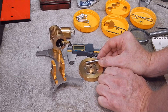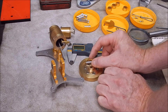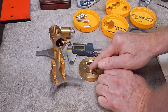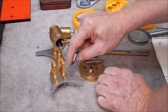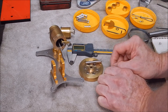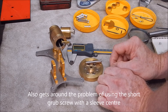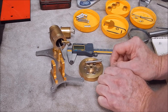By doing it that way, you can have the bigger centre journal for the flywheel and also extend it out to touch the sides of the bearing races, so you can eliminate most of your shims — if not all of them if you get it dead right. That's all just less chance of friction. That's the plan, so I'll get on with it.